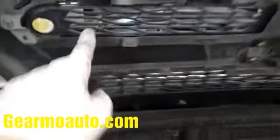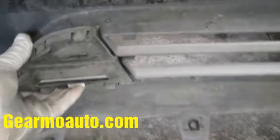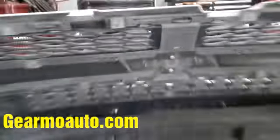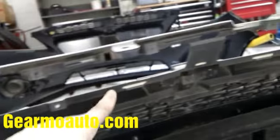These are basically the vents and grills — they all have screws. Just get the screws out, undo the clips, and they'll pop right off. Then attach them to the other bumper. Same with the foam bumper — get that off and switch it over. Switch everything over and make your new bumper look like your old one. The emblem is just two screws — it's easy, just time consuming.